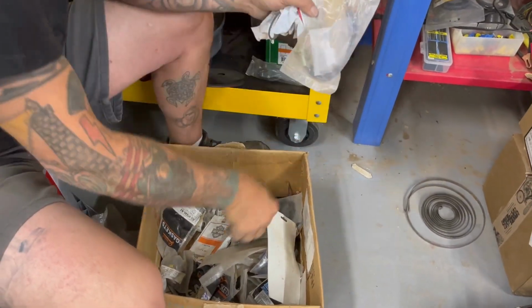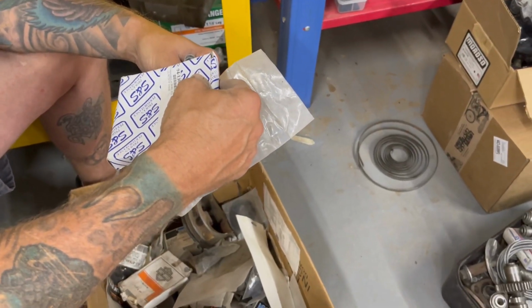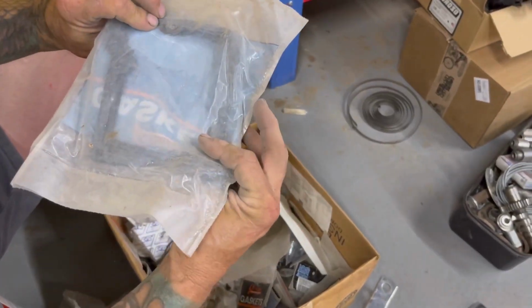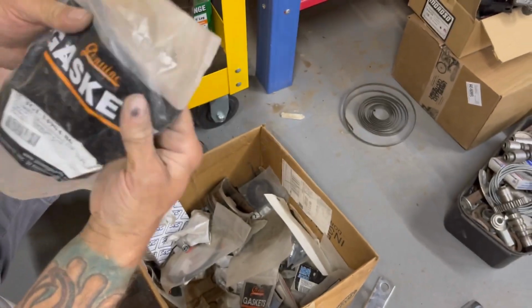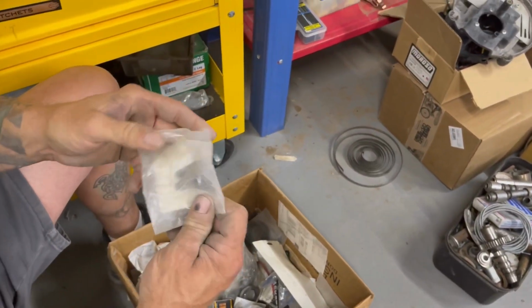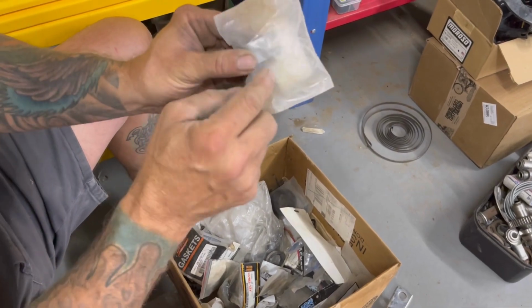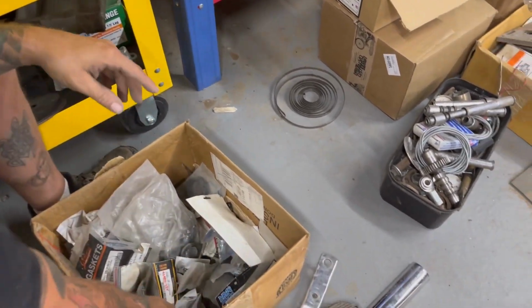That's your primary cover adjuster on a Shovelhead. Sets of rings, 4-inch standard stroke. Wow, S&S rings. Transmission top. Oh, like the other 10-pack wasn't enough. There's 10 more. Any of you guys doing 5-speed stuff, you need transmission gaskets, let me know. I got 150 of them, it looks like. Hey, those are handy. So that's your little claw that goes down in the transmission where your clutch arm goes. Those are notorious for breaking. There's a brand new one in the pack.